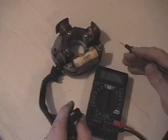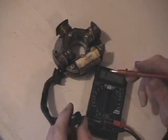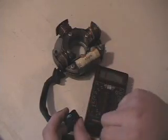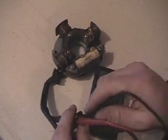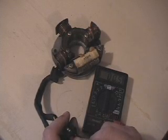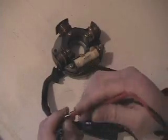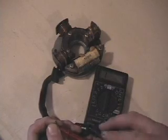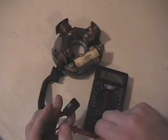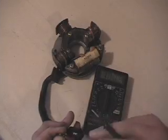We can check our lighting coil first. With the large gauge wire, you're basically just looking for continuity — it's going to be very low ohms, usually under one ohm. It doesn't matter if you use negative or positive leads when you check these. Most lighting coils, whether this model or other models, will read around 0.4 to 0.5 ohms. On my multimeter set to the 200 setting, I'm reading 0.5 ohms on one side and 0.4 ohms on the other. That's all we're looking for — just continuity.